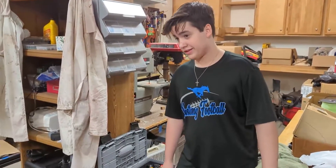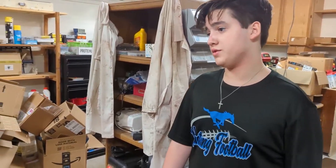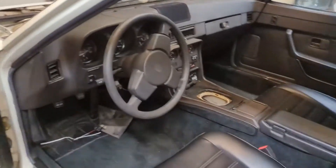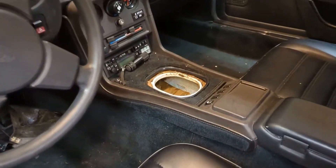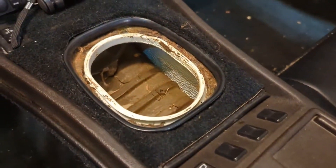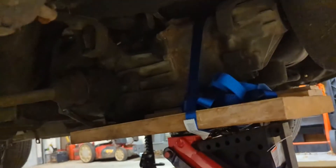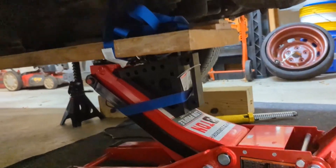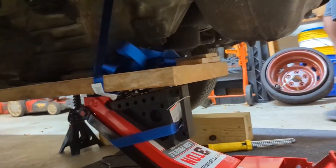Today is day 47. We got the gearshift out, and came back from the car under the transaxle and took out four to eight bolts. We kind of made a little contraption to lower the transaxle because we don't have a transmission jack — we just have a regular jack — so we built a little wood platform.